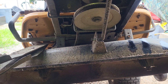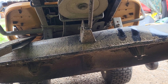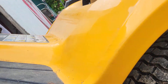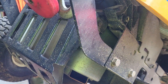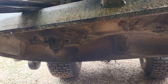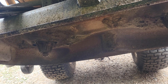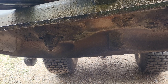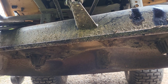He's complaining that it's cutting — one side was cutting lower than the other. I thought maybe first of all check to make sure he doesn't have a bent blade, and then maybe it needs some adjustment. There's one on each side where you can tighten or loosen that nut to adjust the side to side. I went ahead and took the blades off to sharpen them up. They didn't appear bent — I spun them around and they didn't look bent at all. I was going to double check on the level on the bench, because sometimes really dull blades could make it look like it's cutting shorter or something.